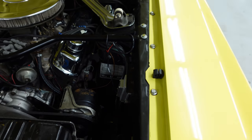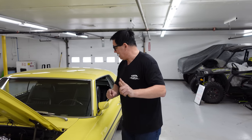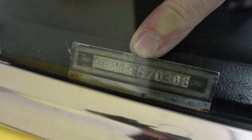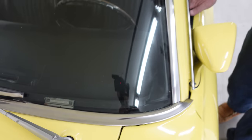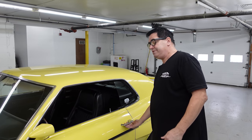It's interesting to see that it's still there. Of the 2,411 Eliminators built in 1969, only 169 have a G-code. In the fifth spot, the G tells us this was a Boss 302 canted-valve, solid-lifter, aluminum-intake, Holley 4-barrel, dual-exhaust, 290 — very underrated — horsepower SCCA Trans-Am homologation engine. Mercury Cougars were run in the SCCA series, as were Boss 302 Mustangs, so this was a homologation piece for SCCA racing.